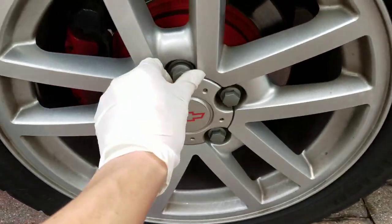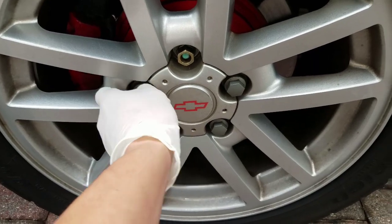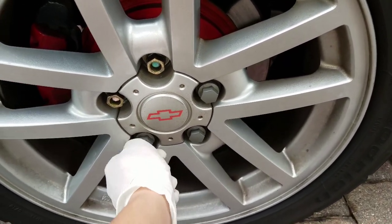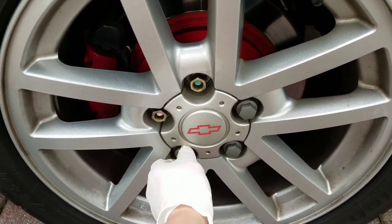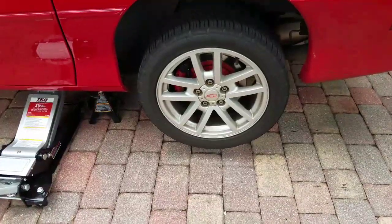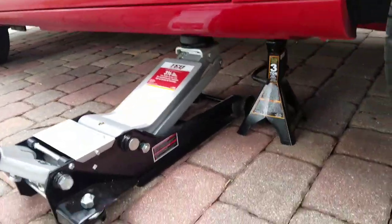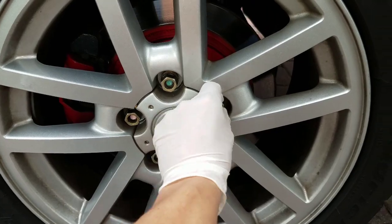With the vehicle still on the ground, be sure to take off all the lug nuts. If your car has plastic covers, remove them and take off the lug nuts while the tire is still on the ground so it does not rotate. After you've got the nuts cracked loose, then it's okay to raise it up in the air. Go ahead and remove all the nuts.